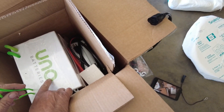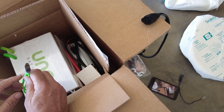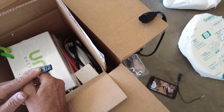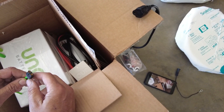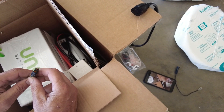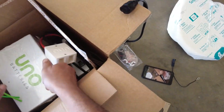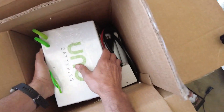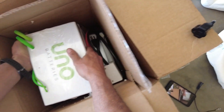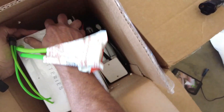I really like the color of the Uno battery — it's white and green. This is where the charger interfaces, called the charge port. It uses a D-shaped plug, so it's easy to get the polarity correct when you plug it in. Here we have the junction box. Pulling out the Uno battery, she does have a little weight to her, but it's the same size as a six volt golf cart battery.